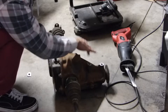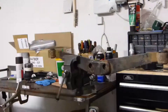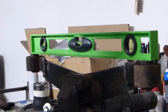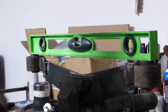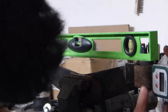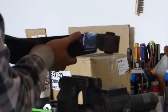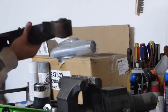So I'm going to be running off this bolt, this bolt, and then the two bolts in the rear — four bolts total holding it in, which is typically sufficient. I might end up adding a little cradle underneath. Going across it's pretty close to being level, ever so slightly off, but that shouldn't be a huge deal. We can make sure our bolts are straight — measuring 89.4 and 89.6 degrees. So now we can get this thing fully welded in. These look like either 3/8 or 1/4 inch plate, probably 1/4 inch.